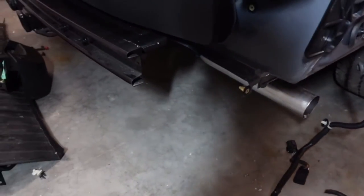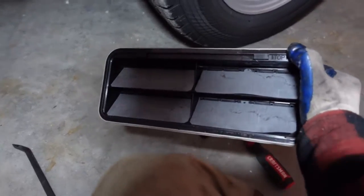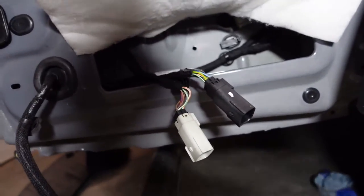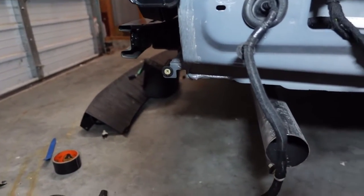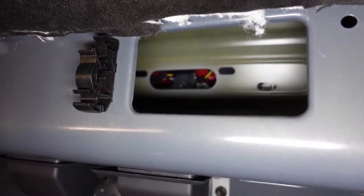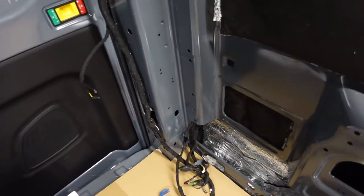All that pulling off the bumper and going all the way across - never mind, don't do any of that. Once you get this side off, pull this little filter out by undoing the tabs, and there are two connectors right in here - one for the backup camera and one for the upper tail light. They just unclip. All of that bumper cover removal actually didn't need to happen. The rest of the harness just unfolds going toward the front, and the driver's side is very similar.